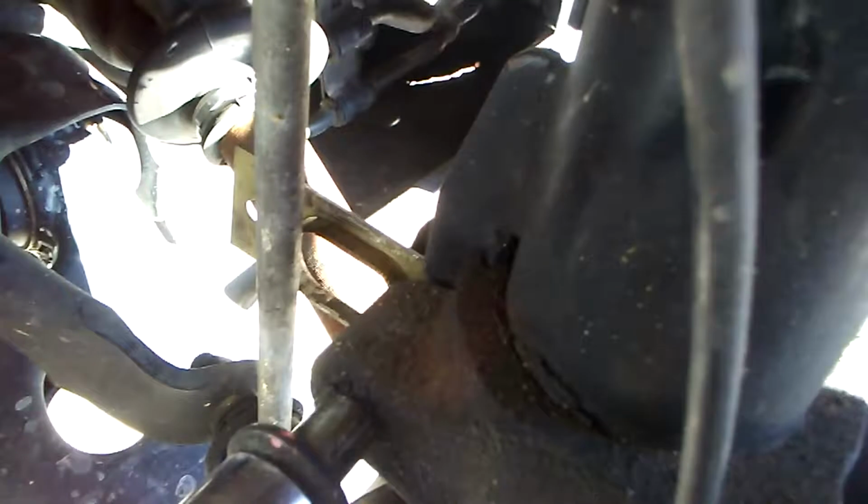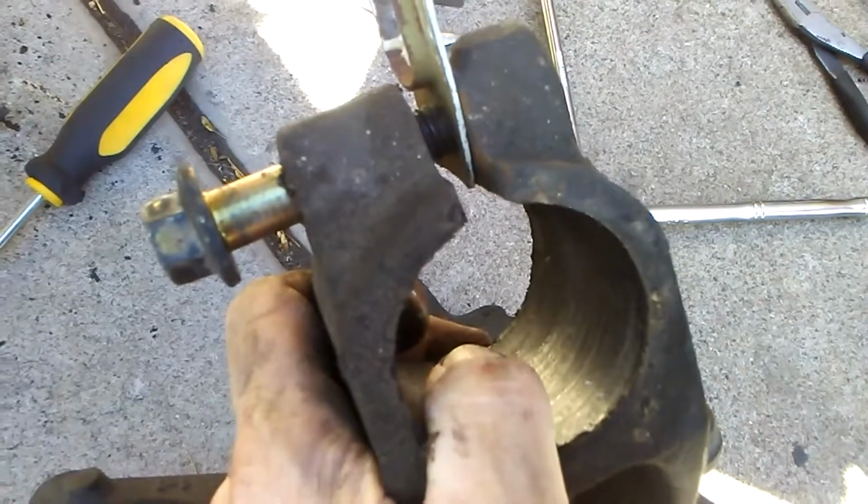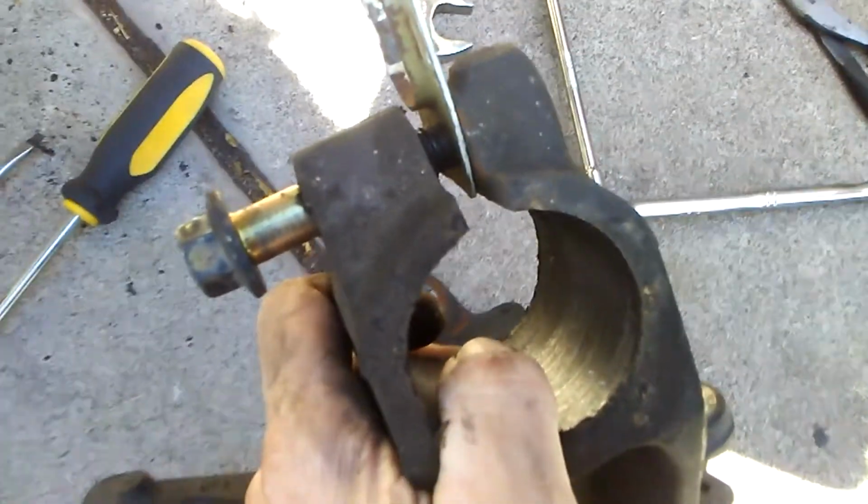And well up against that piece of metal, just start applying some tension, and it will spread the clamp that is clamped around the strut. You can see it's already loose. You can see that the dirt bond has broken, and this will fall straight off, so I have to put the camera down so I don't hurt anything. That works much easier than trying to force it.